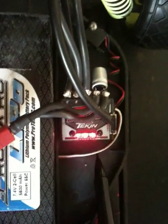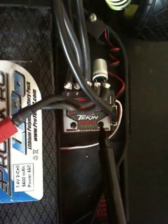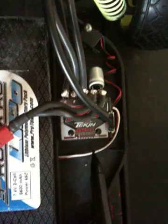Let the system reboot. Basically, that's my new drag brake setting. To confirm that, I can hit the mode button one time, hit the increment button one time, and you can see that it's all the way over to the 7 LED. I obviously don't want to leave it there, so I'm going to adjust it. Watch the LED drop all the way down to the one side — that's no drag brake. Let it reboot, and now that setting is saved.